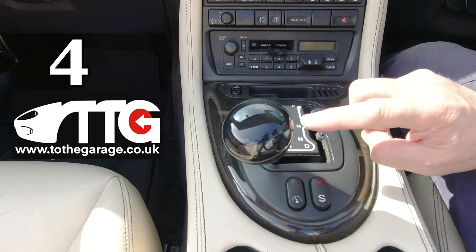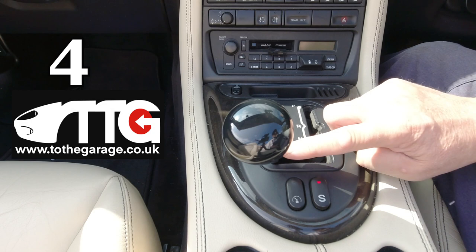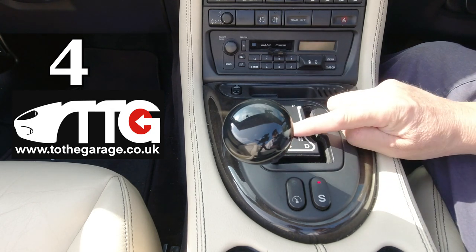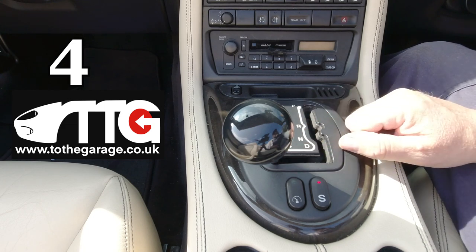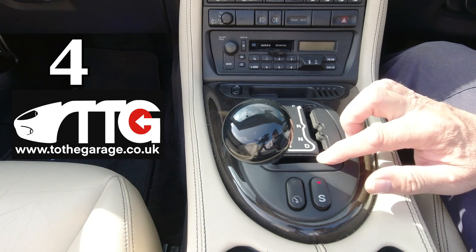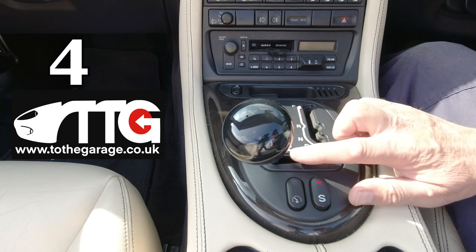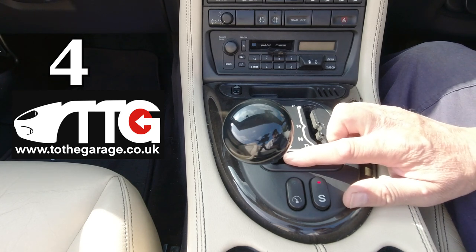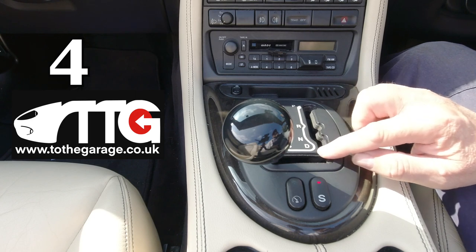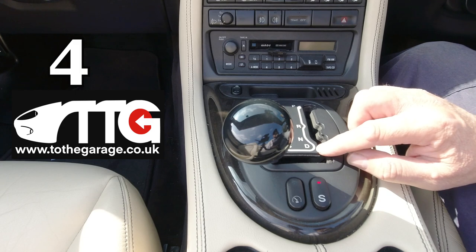If I have the gear stick in 4, then what that means is the car is capable of selecting 1st, 2nd, 3rd, or 4th, depending on driving conditions, but it will not select 5th. 4th is the highest it will go. And you can over rev the car. Because we're not in neutral, the rev limit is now 6,800 RPM.